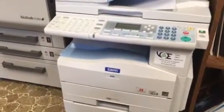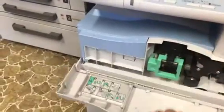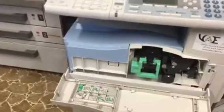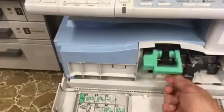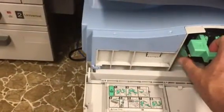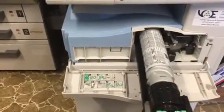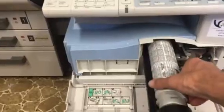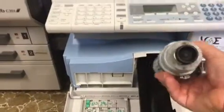The first thing you do is open the front door. Now the toner — everything in green there is user friendly. What you do is you lift up the green handle, and then there's also a little tab here you push to the right, which releases the cradle for the toner. Slide the toner back toward the rear of the machine a little bit, and then up and out.